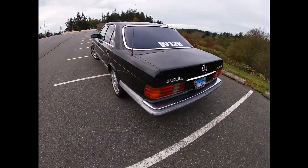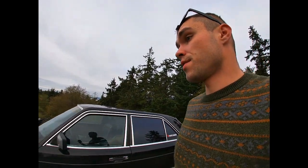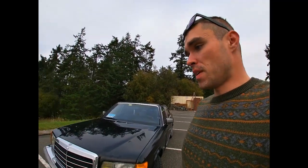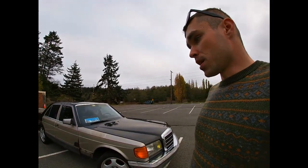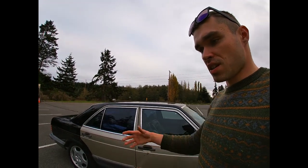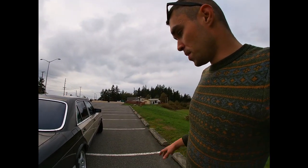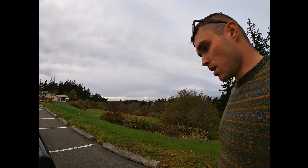Now moving on to water leaks — this car isn't too bad as far as water leaks go. It does leak some water in the trunk after heavy rain. I removed the carpeting and trims from inside the trunk to get to the pockets and inspect them. They actually look pretty good — some surface rust here and there — but I cleaned all the moisture out and put a lot of wheel bearing grease on there, so in the meantime it's not going to rust out. I'll leave a link down below if you want to check that video out.